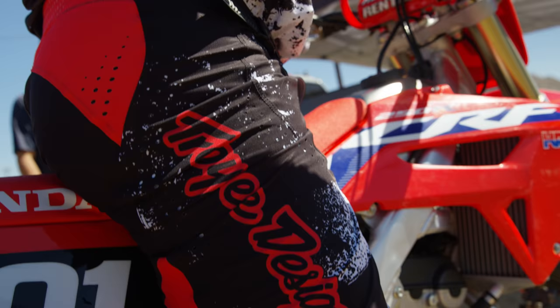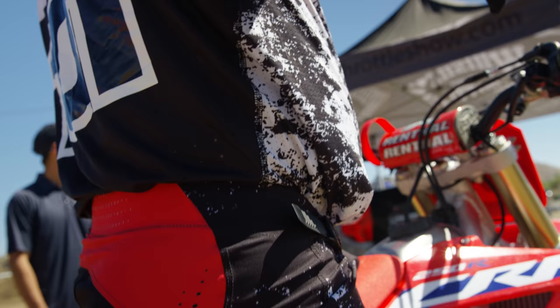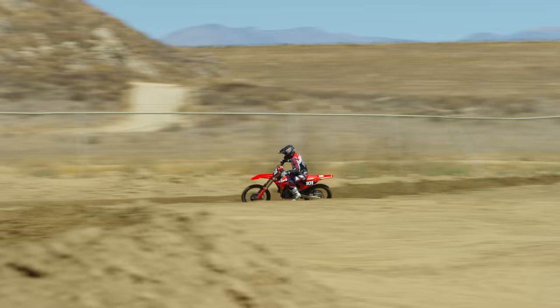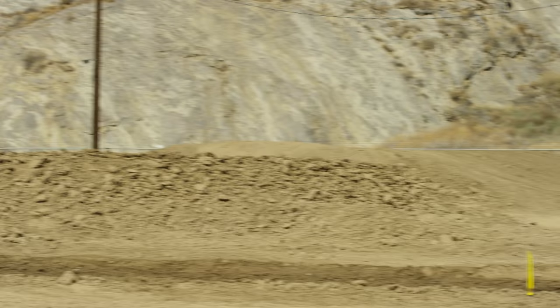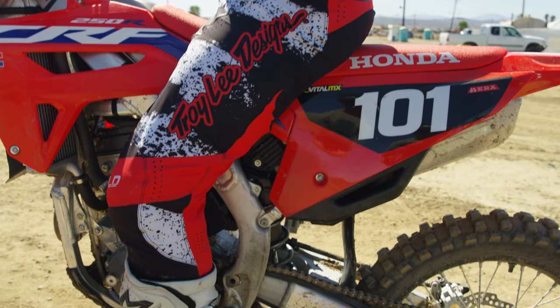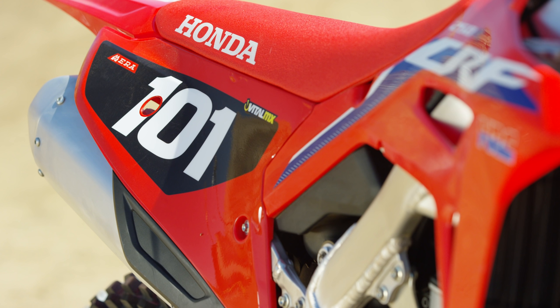I want to reiterate how important sag is. On the Honda 450 we had sag at 102mm because it was new and we thought it would break in — it felt stink bug the whole time. We brought it back and set sag at 105mm, and it was perfect. Three millimeters isn't much to look at, but that change made all the difference in balance and feel. The Showa tech also wanted us to convey the correct way to measure sag on this bike: sit a little further back so your butt is right between the H and the O in the Honda logo on the seat — that's their intended balance point.